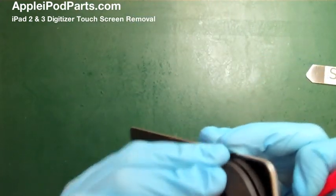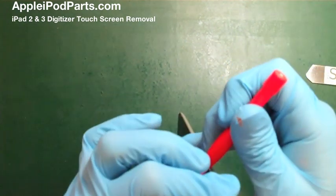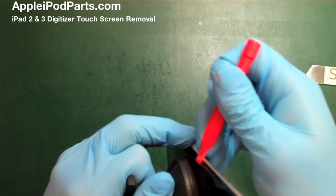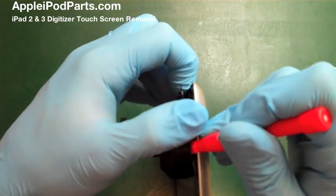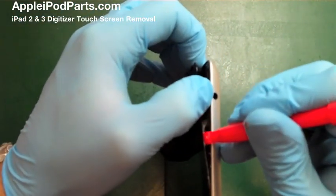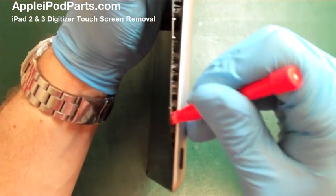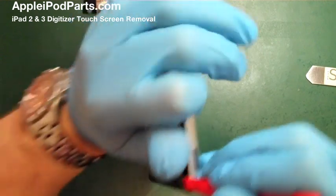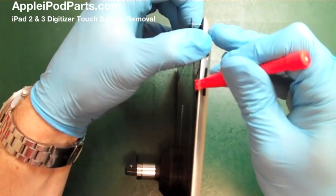Then we use this plastic sacrificial tool — they break rather than your device — and we slide that all the way around. It's a fiddly job, especially doing it on camera. You can see the tool is going between the glass but I'm keeping it against the metal casing and not the plastic surround. If you start digging into that plastic surround it's not going to look good. That orangey-red tool is levering between the glass and the metal casing, not the plastic. I'm doing my very best not to run it along that plastic edge, because if you take the tip off it, the actual plastic edge looks rubbish when you put a new screen on.